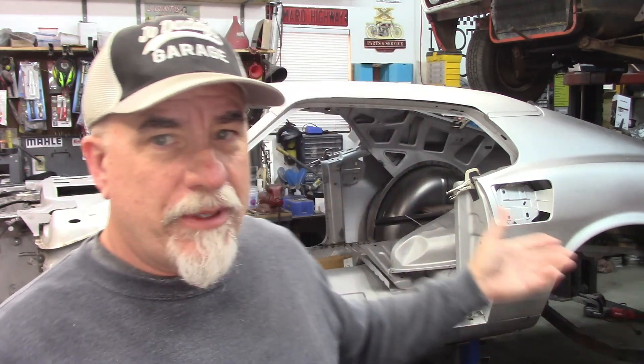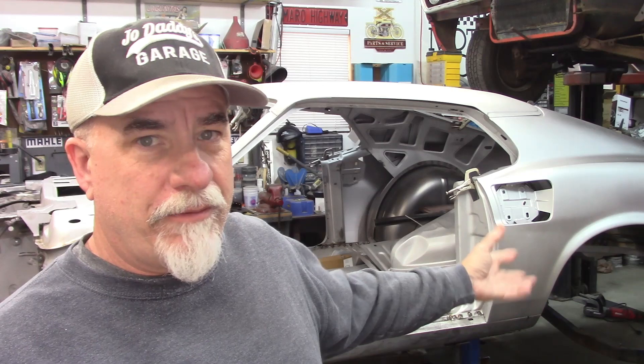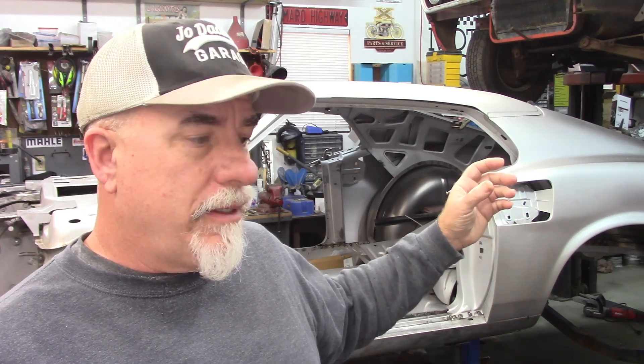We need to come to some decisions as to how much further we want to go with the parts that Charles has already purchased. If we're building the car back to a stock style 428, we don't need the high-end race car style suspension underneath the front of the car. In the rear, we can go back with the original rear differential, get new leaf springs, get new shackles, and rebuild everything back there from the original pieces.